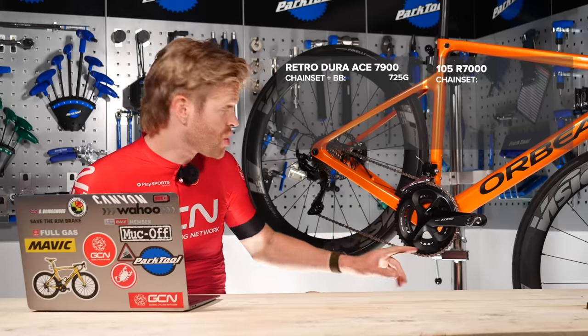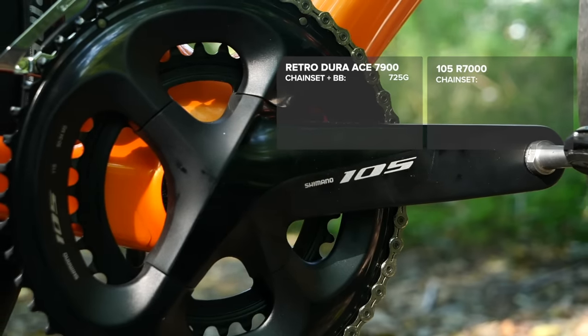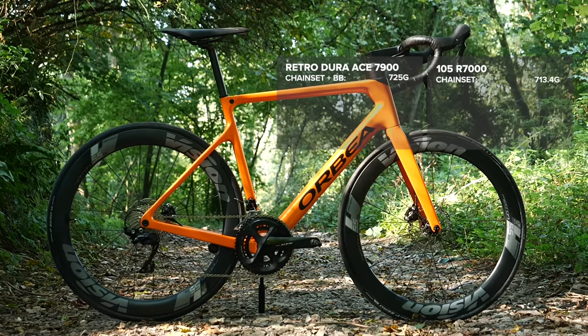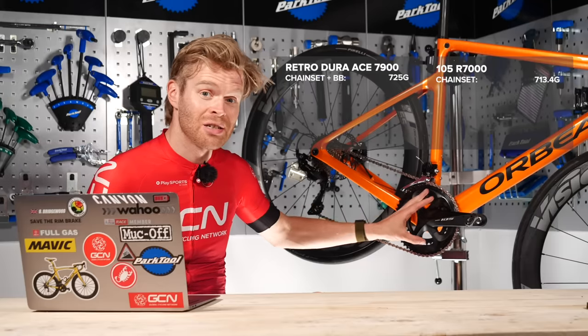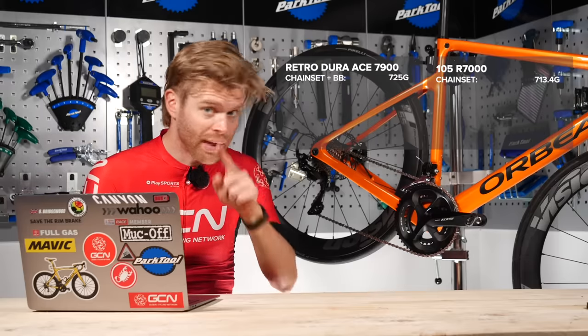R7000 105, that has switched to the four-bolt chainset design that we see on the current Dura-Ace and Ultegra as well. So it's got that, and that comes in at 713 grams. I mean, that's really amazing. This chainset, lighter than the Dura-Ace one, and it's also said to be stiffer as well, with a better design. Also has universal BCD, more on that later.